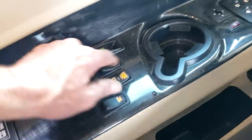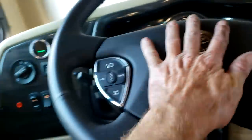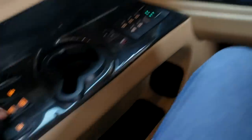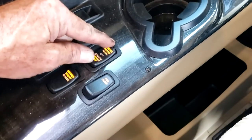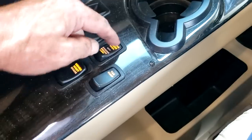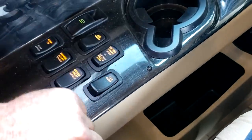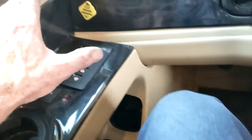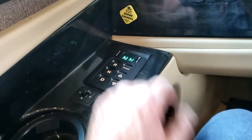Air horn — just what it sounds like. Engine brake: if you're not familiar, this is a true Jake brake or compression brake. Middle is the off position; put it in high or low. When you let off the accelerator you'll actually feel the engine slowing you down. It's also tied into your transmission, so it will shift you down automatically.